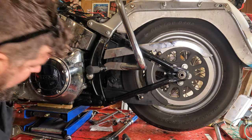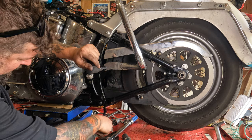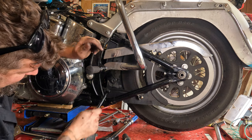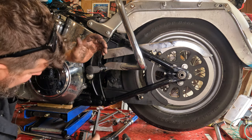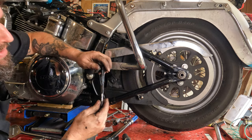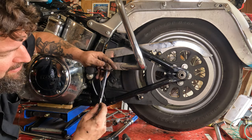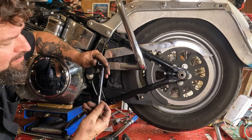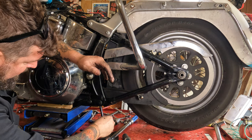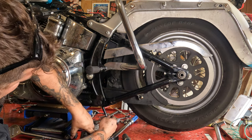So Harley recommends half inch of deflection with 10 pounds of force. Half inch, 3/8 of deflection. On some of them, you have a little window here, which is great. This one doesn't, so we're going to push it through the middle there, and it's not even perfectly straight. But I have this little belt tension gauge I got on Amazon, and there's a little mark on it here that says 10 pounds. You probably can't see it, but I swear it does. Either way, we're going to push this up here and push on that belt tension to the mark.